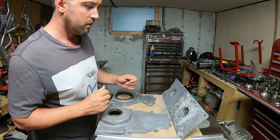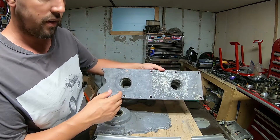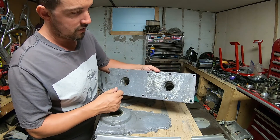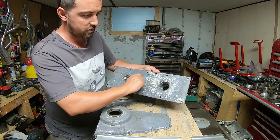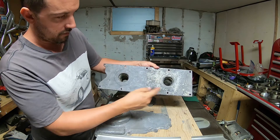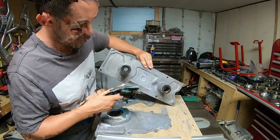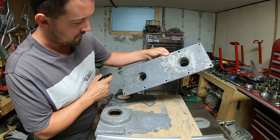However, depending on where you live and what your cold weather is like, some pieces are more stubborn. On this piece here, a lot of the grease and grime came off, but there's still aluminum corrosion — like barnacles on the surface. Even vinegar and degreaser won't take that off. You have to let it dry and then work at it with a wire brush. I did a half-and-half demo just to show you. The surface is also pitted from the aluminum corrosion, so this piece might need to be replaced.